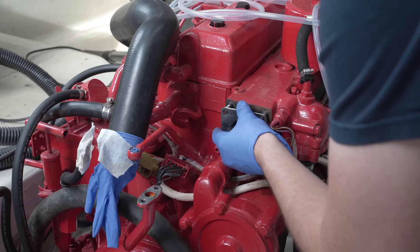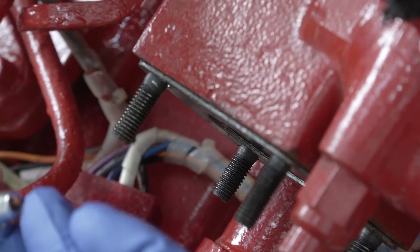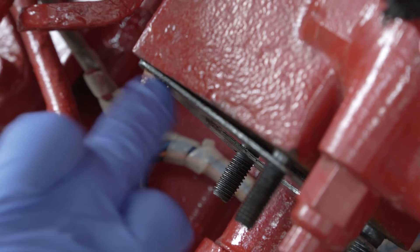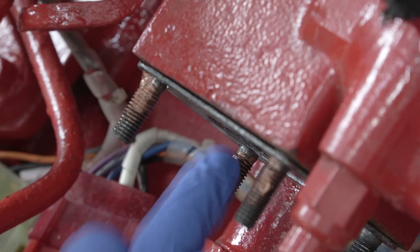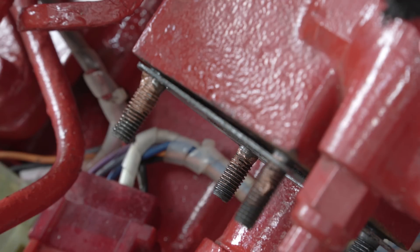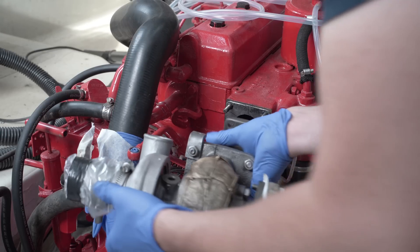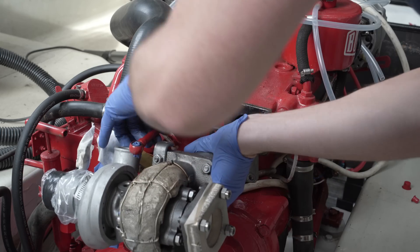The gasket fitted onto the clean steel face and studs, and then I'm protecting the studs. I'm not sure what they chose during the initial factory assembly, but I don't want the studs to corrode. I've been warned against using stainless steel studs as well as more exotic metals. This is temperature-stable copper grease applied to the basal halves first. Then we can slot on the turbo — the unit's significant weight is taken entirely by the engine mount and these four studs. The oil apparatus is far more fragile and not structural.